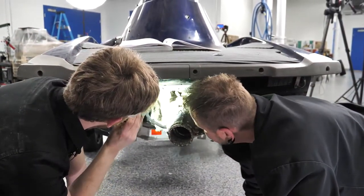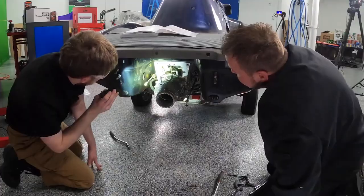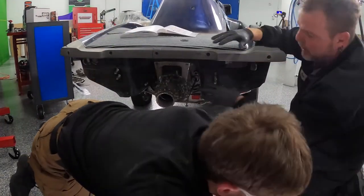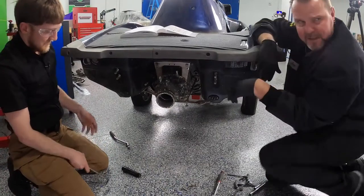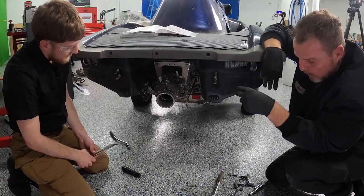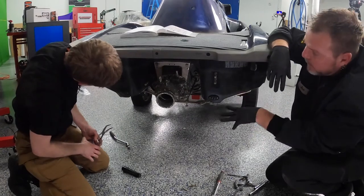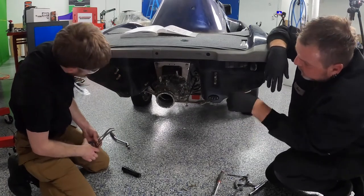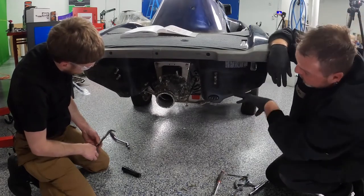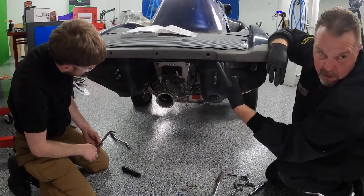Let's go ahead and remove the entire jet pump assembly while we're back here — we'll get a better chance to see everything that way. We might be able to service the cables in there, but it's tight quarters to get to that grommet. We have more work to do to the impeller anyway — it looks dirty and we want to clean it up. Removing the entire jet pump assembly will give us much more access to the cables we're replacing today.